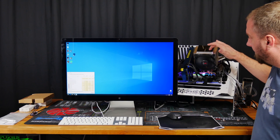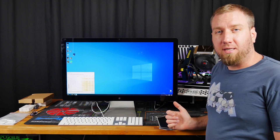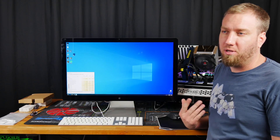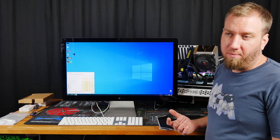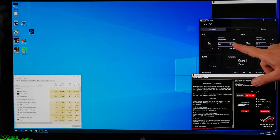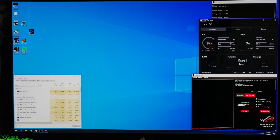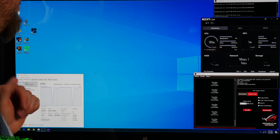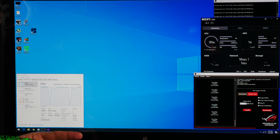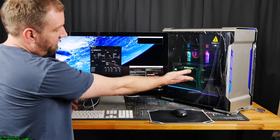I've just got the Shadow Rock 3 installed — you can see it spinning fully and feel air going through it. The fan profile is set to standard tuning, so it should ramp up and slow down accordingly. Before we start, it looks like we're getting down to about 35–36 degrees idle, and it spikes up to 43 the second it does anything. Starting the test — it instantly jumps up to 64–65 degrees, exactly like my water cooler. After about 30 minutes we're seeing 70 degrees on the CPU — a few degrees hotter than the custom loop, but still really good, and it's still really quiet.